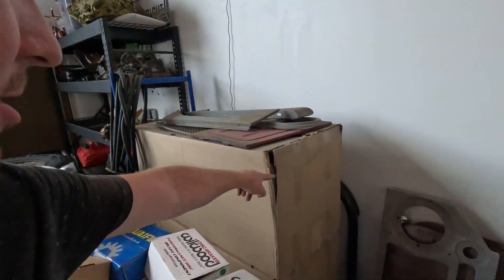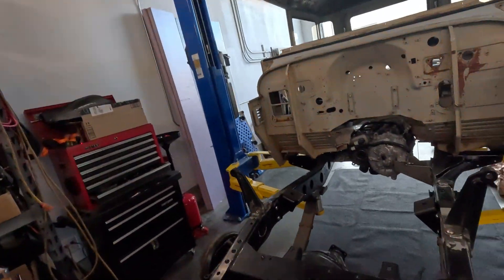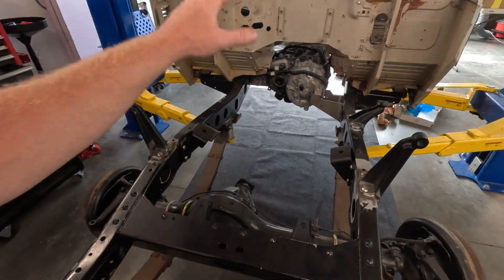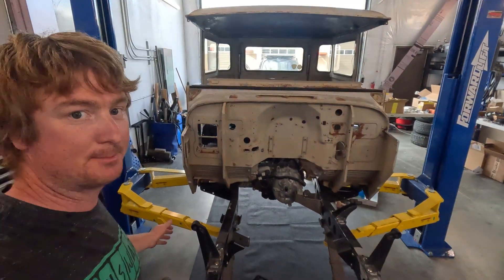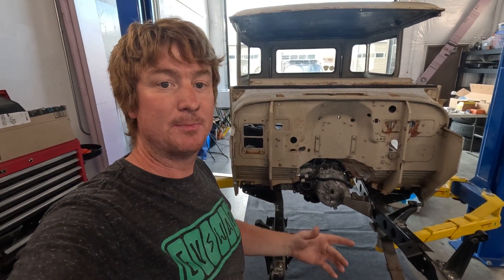The first project is going to be rebuilding the axles — we'll take them all apart, clean them out, because there's probably 30 to 40 year old junk in there. We'll get the differentials out, inspect them, make sure they're not damaged, set the preload correctly, and get everything back together with new seals and bearings, plus the disc brake upgrade. Once that's done, we'll move on towards the electrification: get driveshafts made up for the drive unit and start figuring out where components are going to go. I need to assemble the front end of this truck because that's where the battery is going to go — and look how much space we have for a battery. Massive amount of space under the hood.